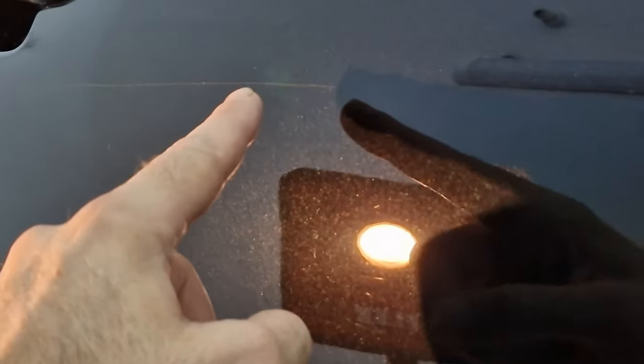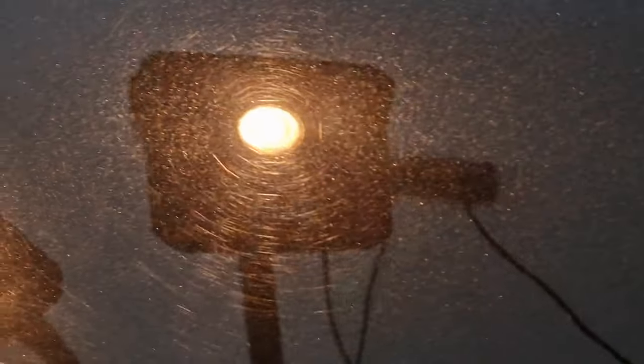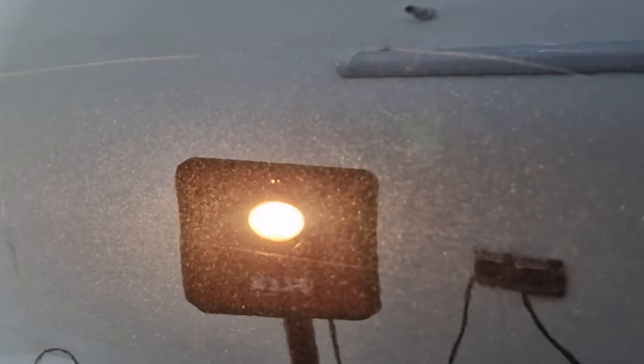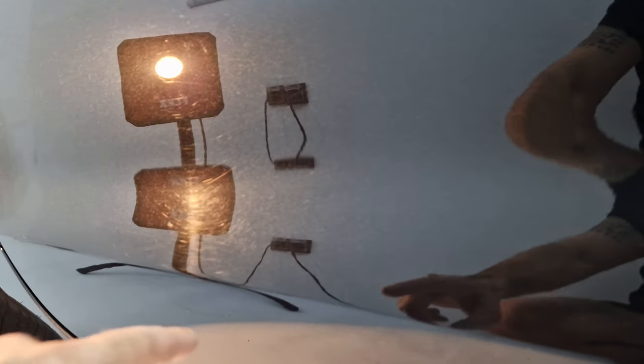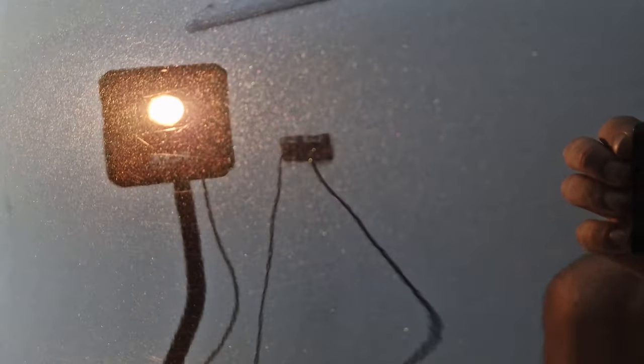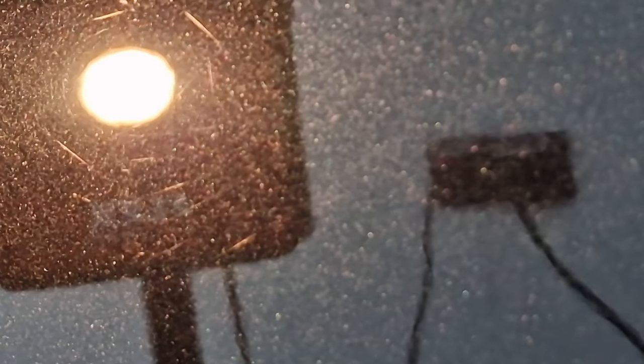Let me show you in detail what we get. Okay — there are a few scratches left, not all of them removed. This big one needs to be sanded down, so we're not doing that in one-step polishing. But look at the difference from the part that wasn't polished — it's quite dramatic. Before and after — there are no holograms in my section, as you can see. Compare that to the lower part right here where you can see a lot of holograms. There are small scratches remaining — this is what you get when you zoom in — so that's about 40 to 50% of the work done.